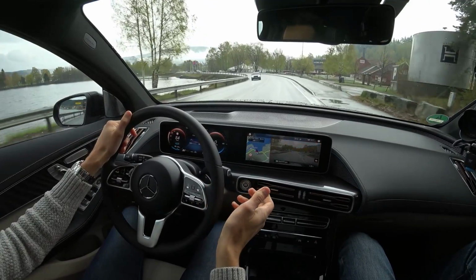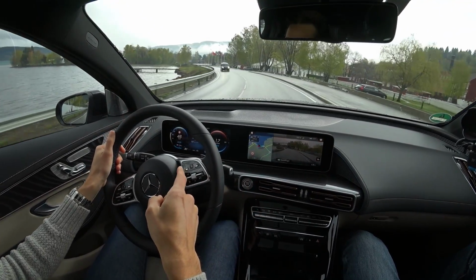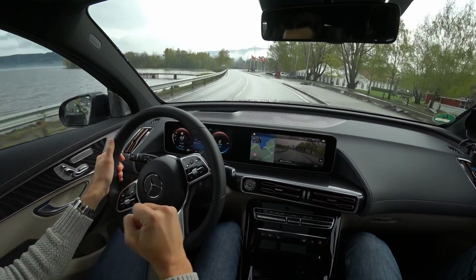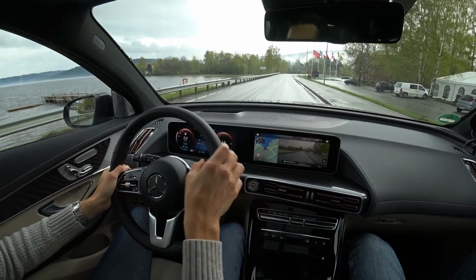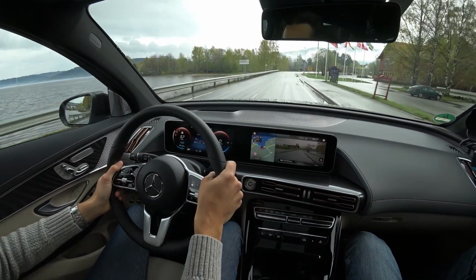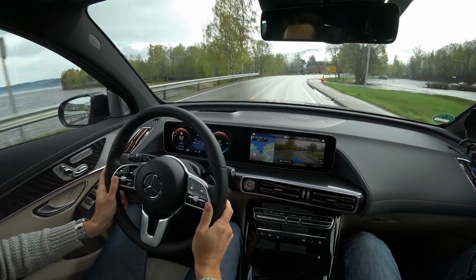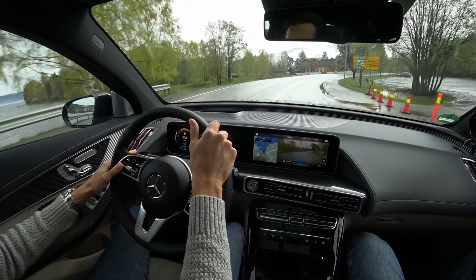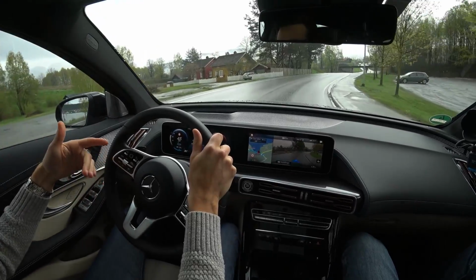And what you can also do is just use normal brakes, and then first the recuperation is being used, and when you really hammer the brakes, then of course the normal brakes are also applied. So a lot of choices you have. They don't go the way with the auto mode that they always have a harsh recuperation. That's just done if you want that.